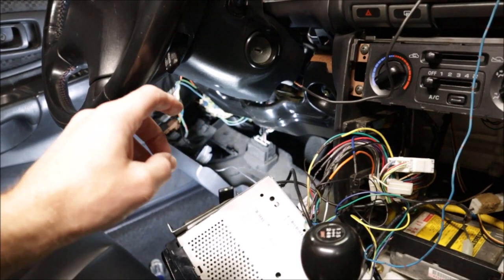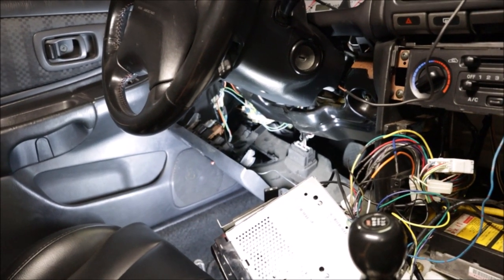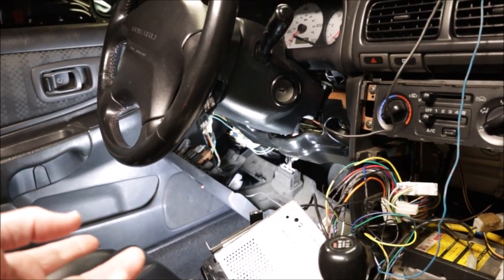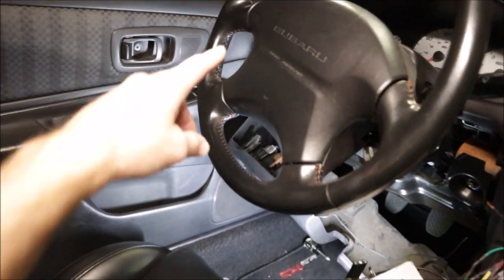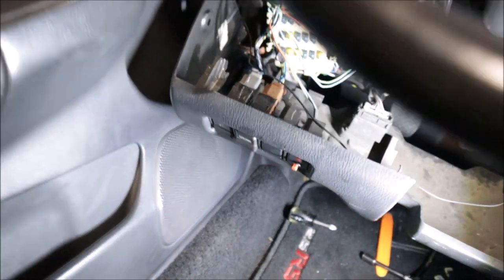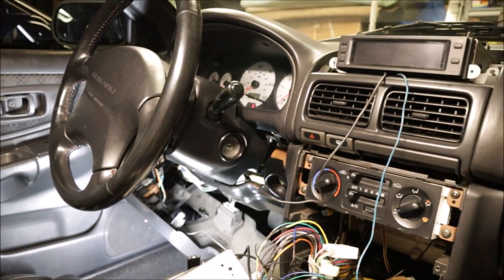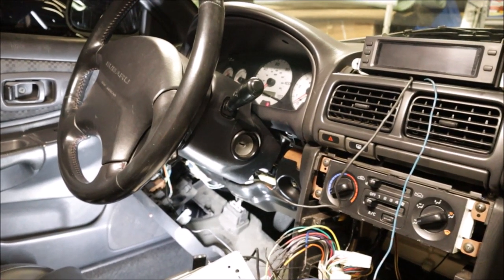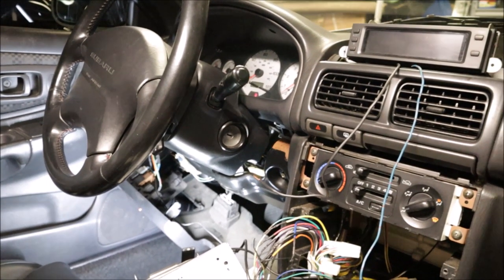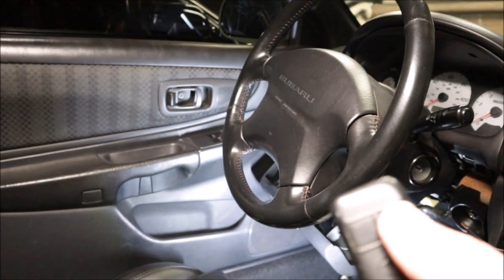And it actually ran to a module that is the security system module, which is interesting because my key fob never worked on this car. I changed the battery, but it never worked. The little light over there by the window, I guess it's down there now, it never blinked, so I didn't know what was going on, but I found the module, and it was unplugged. Totally just unplugged, hanging there, so I plugged it all back in. It started clicking, and then I plugged it back in, hit the button a few times, and we have, you see that?